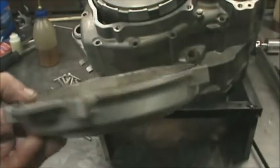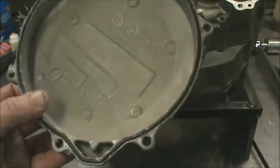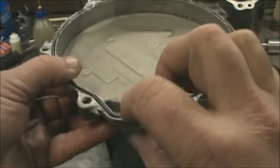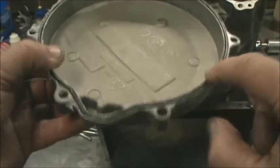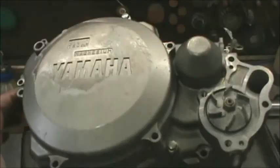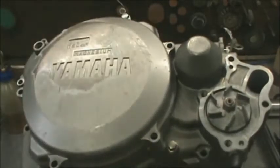Here's another little hint for you. This is the clutch cover — the smaller one — and we can put a new Yamaha O-ring on here. They have these little retainers that hold the gasket in there right. Just take your Vaseline, fill that up — that'll hold that gasket right in there. You don't have to worry about it falling out when you assemble it. I've got this clutch cover on with just one bolt in there, very loose. Next thing I'm going to do is go after the water pump cover.